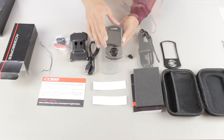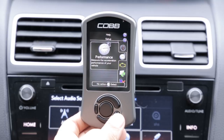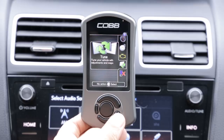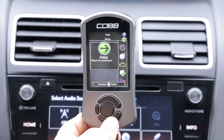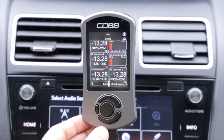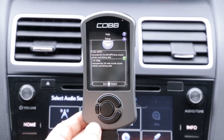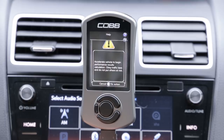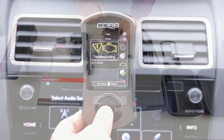The Accessport will allow you to tune your car with off-the-shelf maps that come built in. You can also add a custom pro tune to it. It acts as a code reader — it can read and clear engine trouble codes. It shows engine parameters via gauges on the screen, covering just about any parameter your car exposes through the OBD port. It also has data logging capabilities to monitor performance over time, and it can even measure 0-to-60 times and quarter mile times.